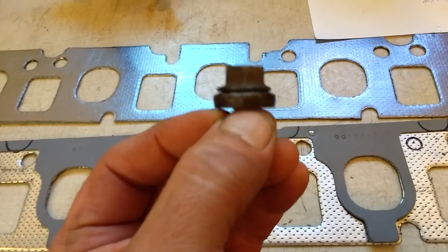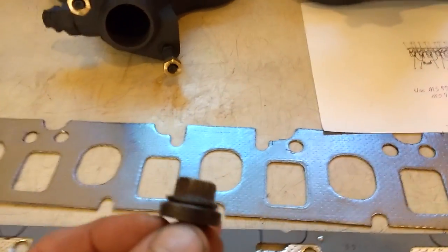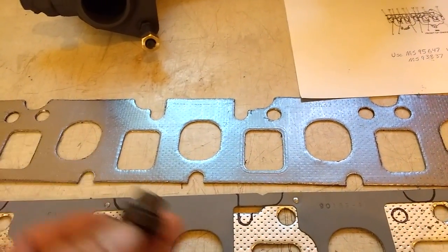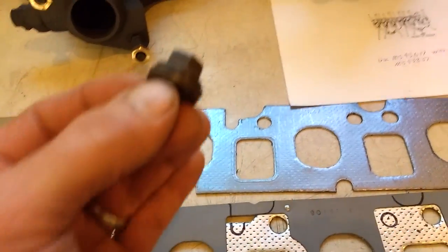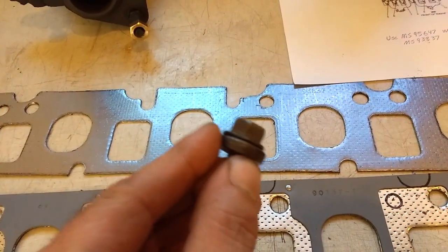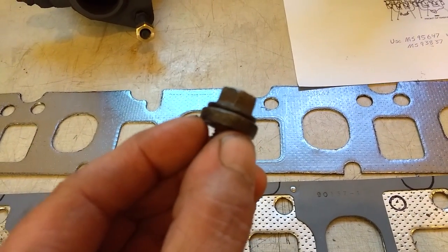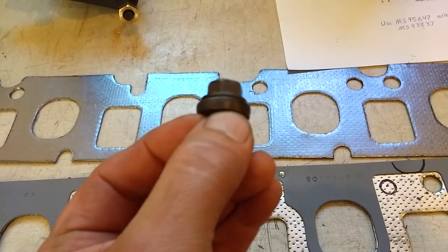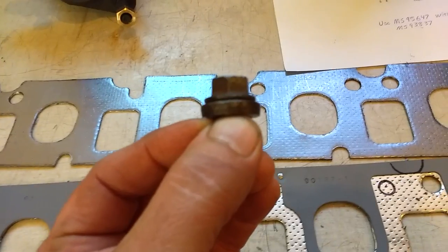What you need to do — let's say you machine your exhaust manifolds 20 thousandths, so you're right in the middle. This is 40 thousandths to make it perfect. Without the gasket it's 40, and if you machine yours 20, you can take some off the washer to make up the difference. Mic up the washers and then check it. The most important thing is that the washer sits flat when it's all loosely bolted together.